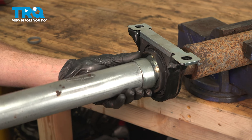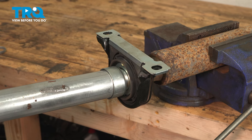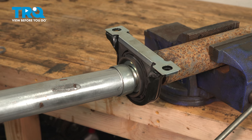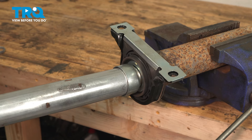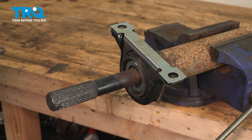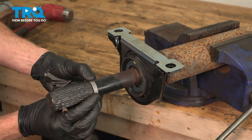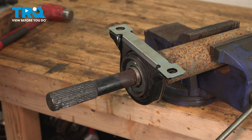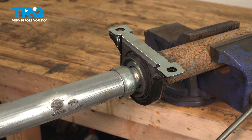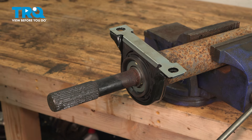I've got a nice long tube here. Let's continue on driving this into place until it's completely bottomed out. As I was driving that in, I could hear an audible difference — it changed from a clicking sound to a clunking sound. We'll pause and have a quick look along the backside here to confirm we are completely bottomed out. As long as it is completely bottomed out, we'll continue on with our spacer across this rearward side. Just give that a quick look to make sure it's completely bottomed out against the bearing.